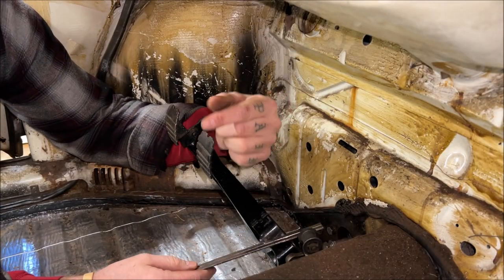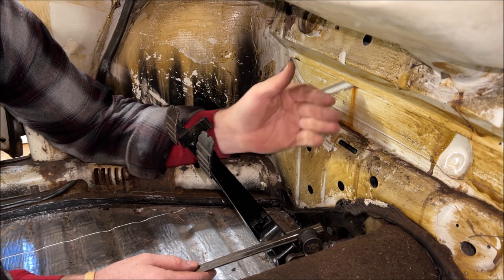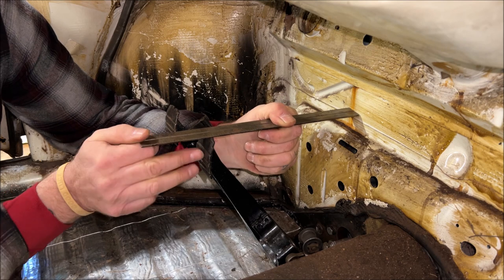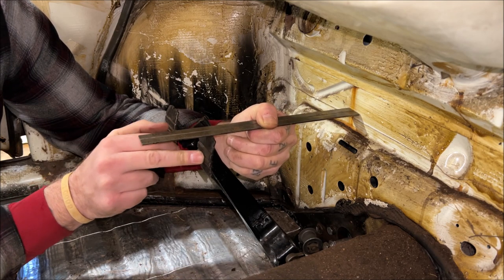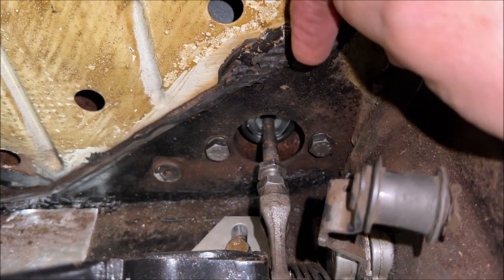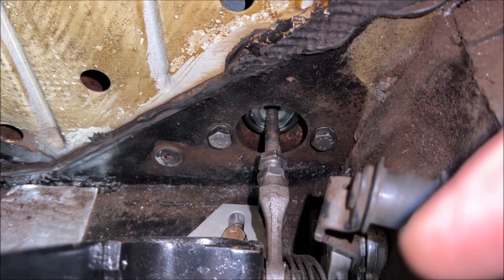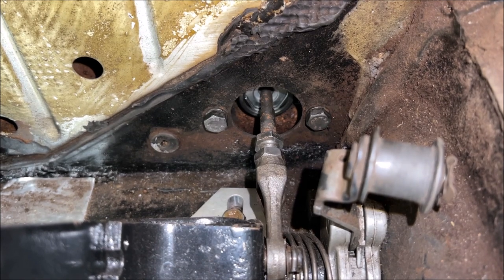When you start out by measuring the distance to get that five to seven millimeters, measure from the top of your pedal. Keep the measuring stick level against the firewall and that's when you're going to check. You're going to check that it's between five and seven millimeters. If it is not, then you are going to break loose the lock nut. Then you can turn the nut that is actually welded to the rod and it will pull it in or out, whichever way you need to go. That's how you will adjust it.